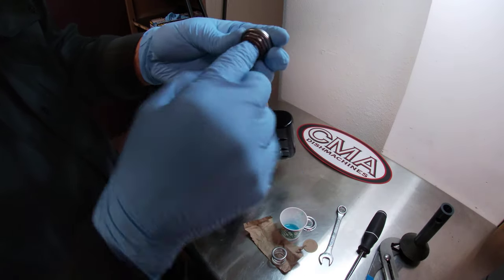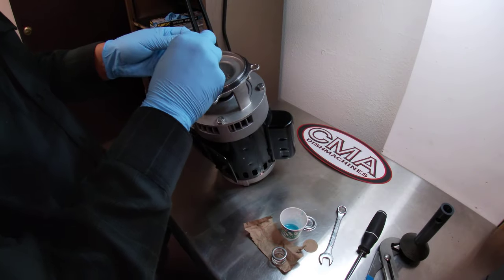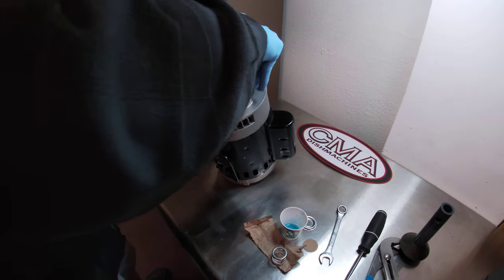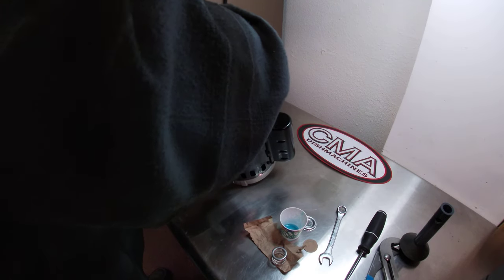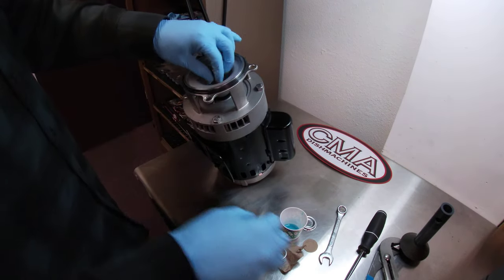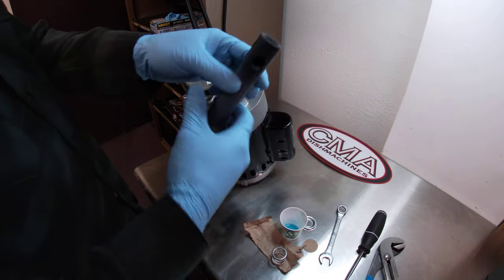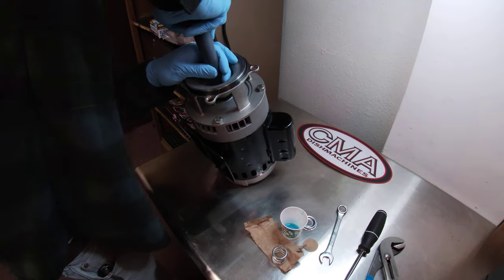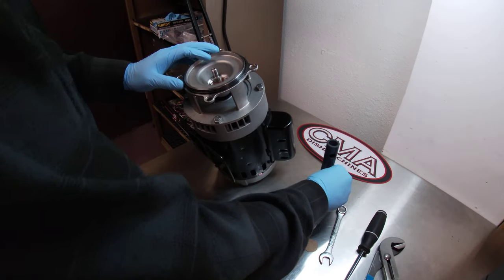So Cesar's going to put a little bit more of our pot and pan detergent inside — it makes it easier to push the pump seal onto the shaft. And now we're using our old drain ball to push the graphite all the way down the shaft.